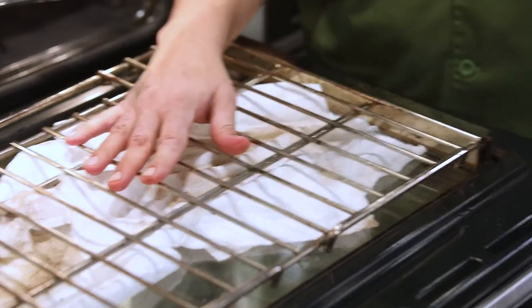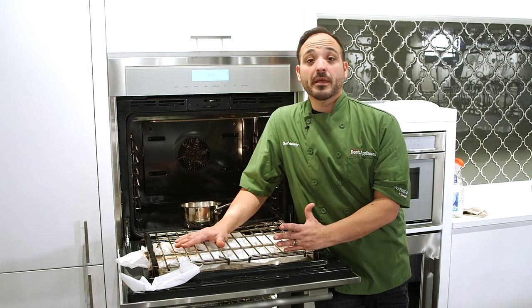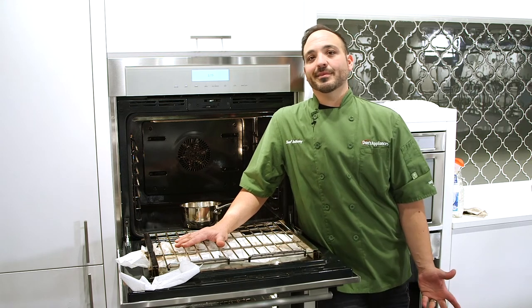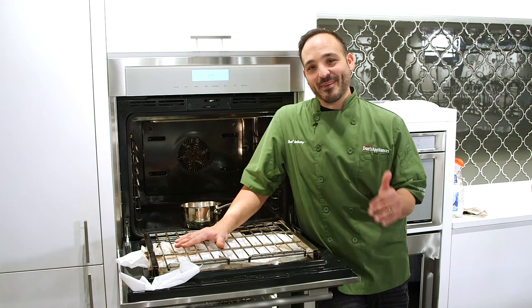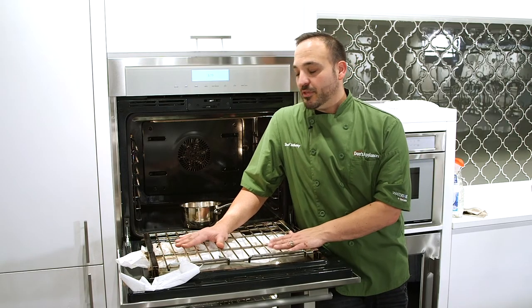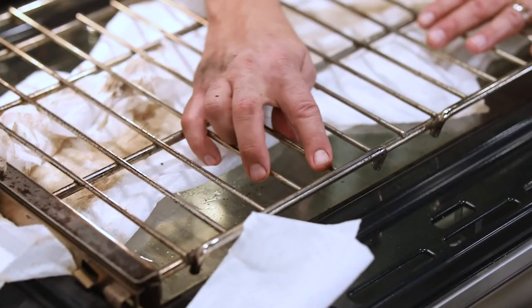This is pretty much nice and easy, but if I were doing the long haul, I would put the racks in a laundry sink, bigger sink, or spare bathtub and soak them in vinegar, baking soda, and water. Two cups of vinegar, fill with hot water, then four tablespoons of baking soda to get that reaction. Some people also have success with dryer sheets in the water to break it down — I've seen pictures of that and it works well. Really soak them overnight, then get a nice brush to get into all the nooks, crannies, and crevices.